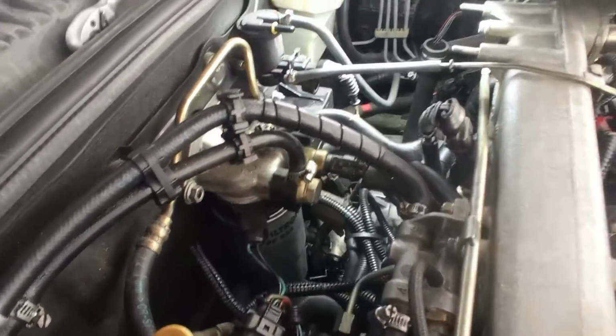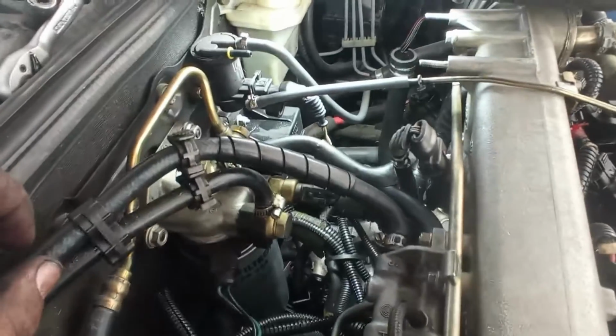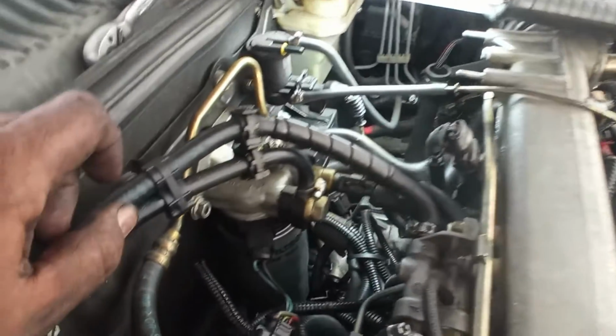Meanwhile, I'm taking out the diesel from the filter, doing a purge, as I call it, to see if there is no water in the system. Meanwhile, assemble everything over here. The starter should be good, and then the power on the road. Let's see what's what, okay?